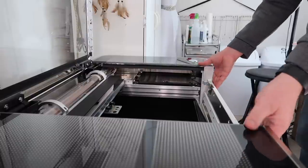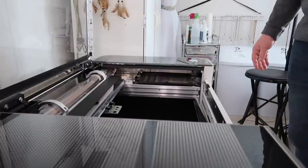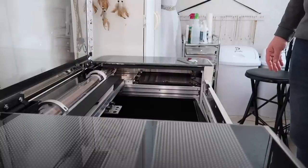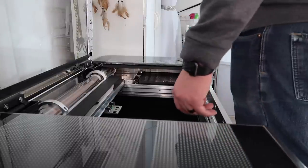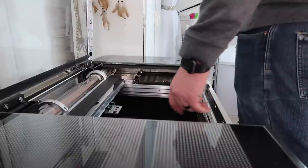Snap the printer head, position the laser arm and metal plate. Gently slide the metal plate on the laser arm all the way to the right, then push the arm to the back of the unit. So push this all the way to the right.